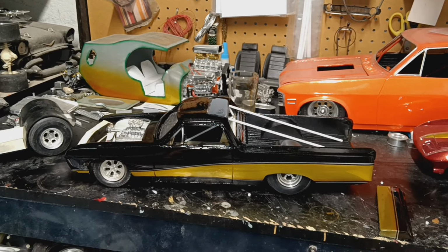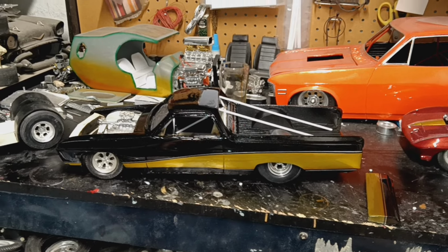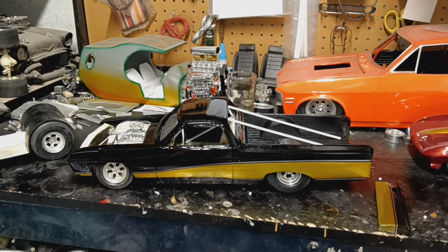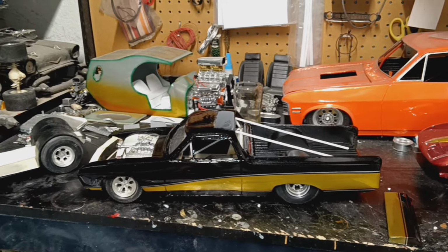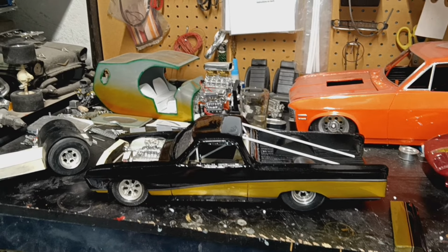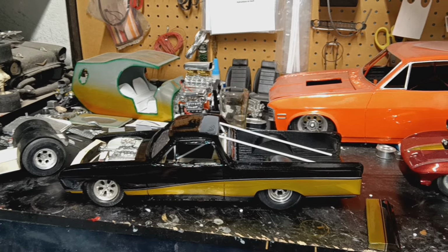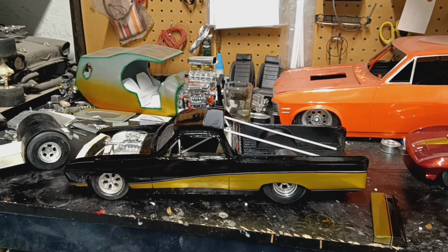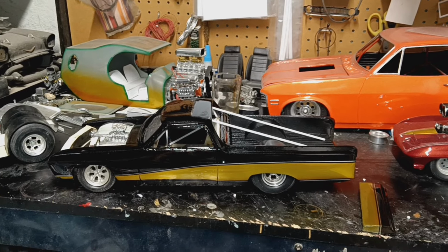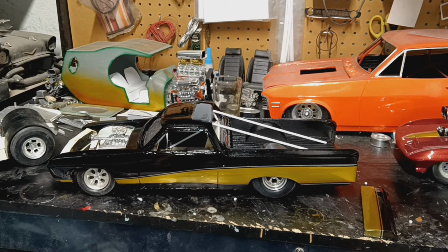But when I painted the El Camino and the hood and the rear trunk lid, or the tailgate, had it baking in the sun an hour or so, it should have been ready to wet sand and flow coat. So I mixed up the clear, and after I touched up the yellow and the orange and the silver over again, shot a coat of clear on her, tack coat, and a couple of good heavy coats, and guess what happened? Thing wrinkled.